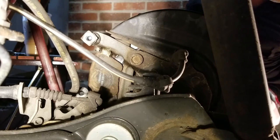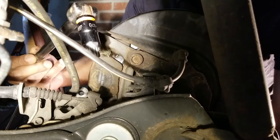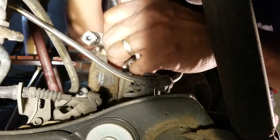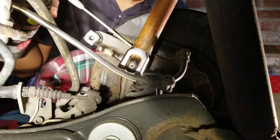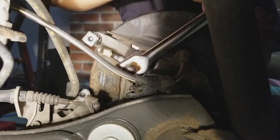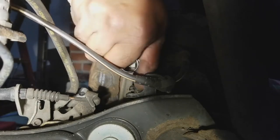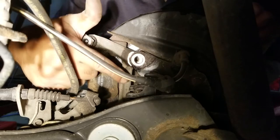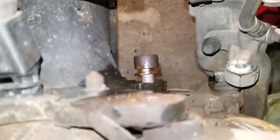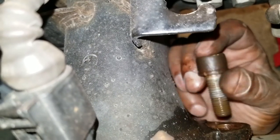The camera is now positioned inside the wheel housing looking out towards me so you can have a better view. I'm going to be using a 12-point Torx 70 to remove this bolt — there are two of them, one upper. Spray some penetrant oil and go ahead and remove it. That's the top one; there's one beneath. Looking down in between, there's the other one — the bottom one is just about loosened up. I'm going to take that out. It's a T70. Now I'm going to slide this off — this is the housing bracket for the caliper.